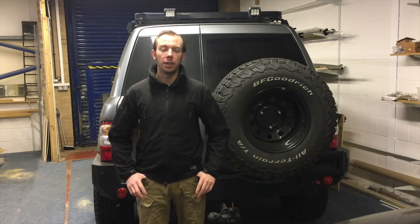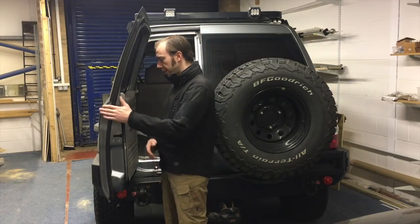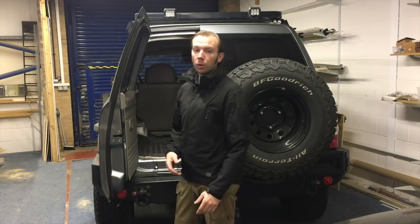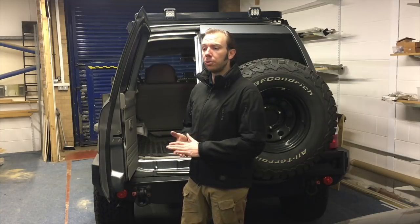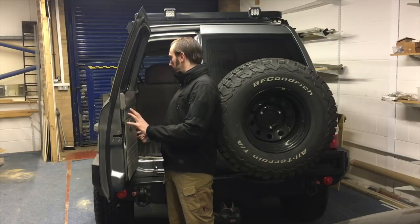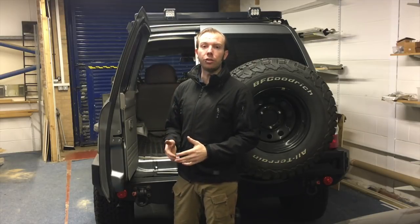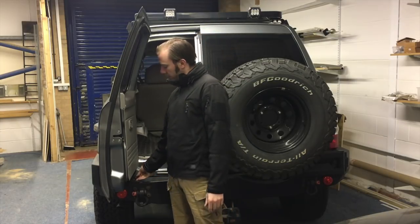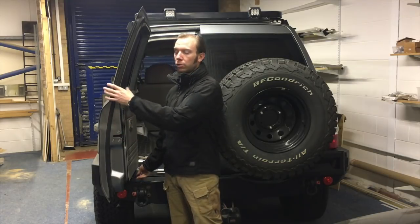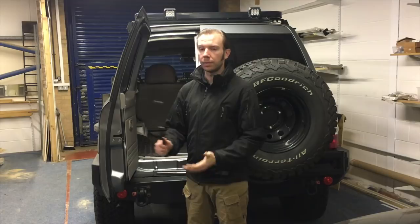Now we've got our barn door opening a little bit wider, it's on to the second part of our modification. Now, if you've ever been out in your Patrol and opened your door while parked on a little bit of a hill, the door swings back into you — or worse yet it's breezy and you get a good clunk by it. The next modification is to stop that. I've seen some builds where people strip down the whole door panel and pack out the door stay to make it a little bit tighter. We could do that, but I'm a fan of a gas strut. So what we're going to do is fit a gas strut to this door. It's going to aid in opening it and also keep it open while we go about our business on hillsides or in the wind.